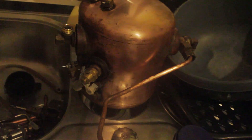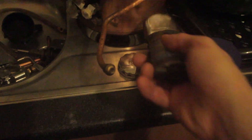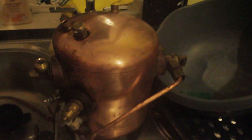I've given that pipe a bit of a polish — I'm not going to undo that one, there's no need. I'm going to Scotch-Brite the whole thing, then I need to get some caps for the ends, upend it, take the element out which is on the other side, giving me a nice big hole. I'll fill that with citric acid solution to descale it, give it a good swish around and empty it out. There's not much limescale as such, but there is some old scale — I want to make sure everything's loosened up and rinsed out.